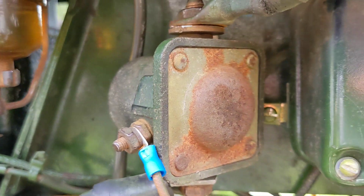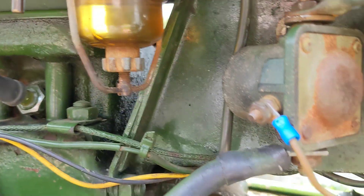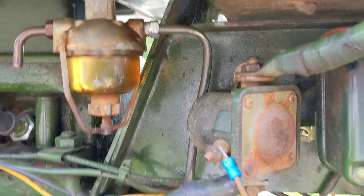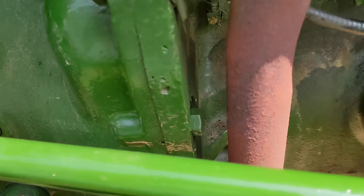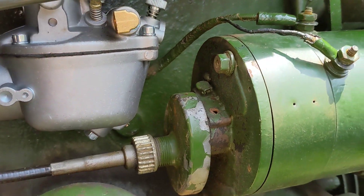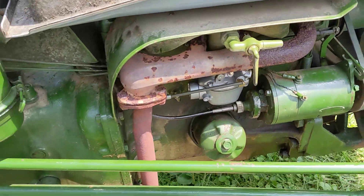That was a little bit more of a pain than I thought it would be. I ended up having to loosen up the starter relay and tweak the line a little bit — that bend, even making it as short as possible, still came in close there. But ultimately got it to fit. Got the 7/16ths nut tightened up — be very careful not to cross-thread that. I had to do it two or three times to make sure the threads were lined up correctly. Before we go ahead and button it up, we're going to get a pan underneath and run a couple ounces of fuel through that line to flush out anything we may have picked up.